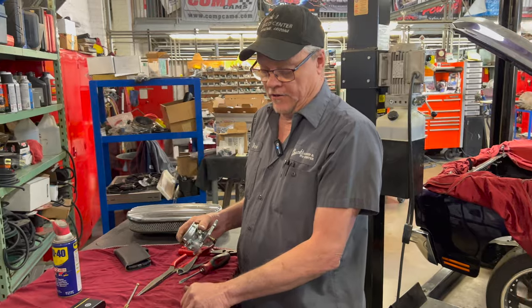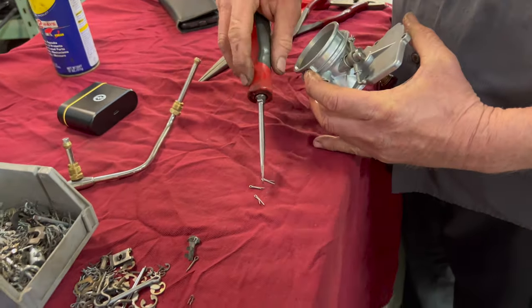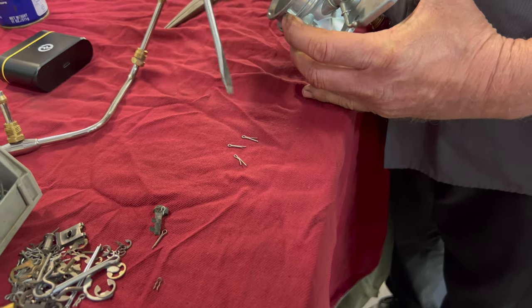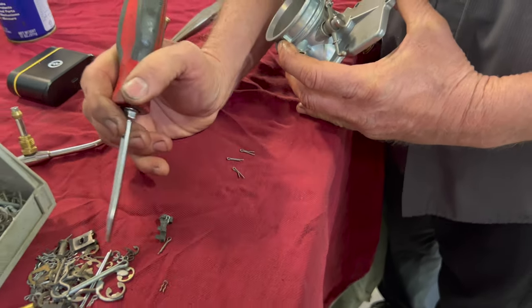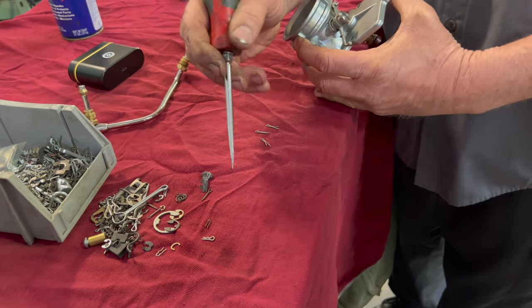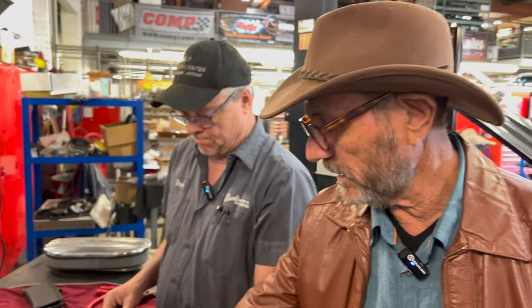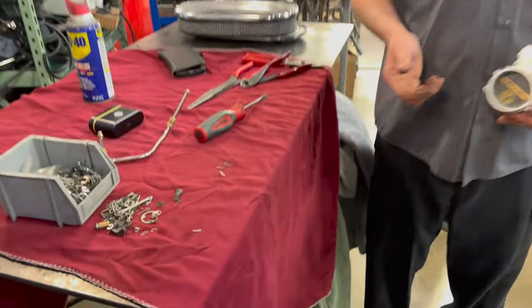And you were asking about why I took that clip out and just did that with it. Right. Because I knew that those are very small cotter pins, and once you undo them, they're not generally reusable. So if you use a thing like a Jesus clip right here, that can be taken in and out a whole bunch of times, and you don't go searching in a toolbox. So this is probably spring steel. Yeah, and it's not going to just fall apart. Snap right inside there, and then I can take that in and out as many times as I want and not have to go searching for it. Very important distinction, because that wouldn't even work. You won't get that back through the hole again. Okay, cool.